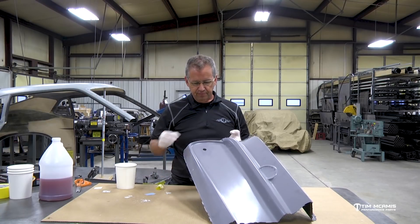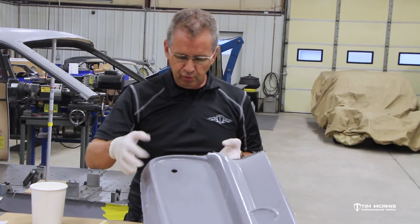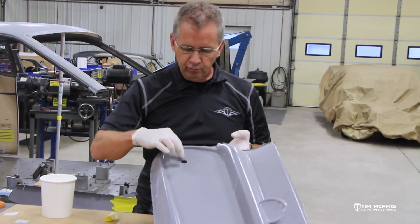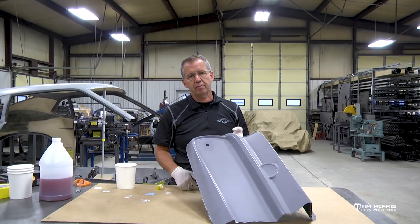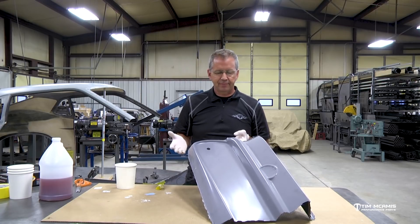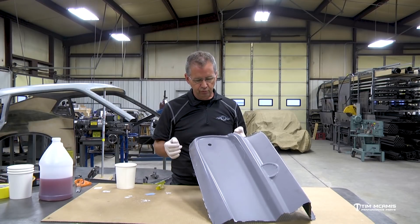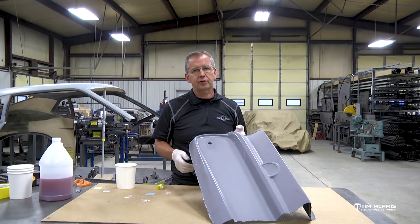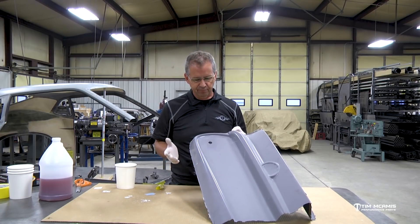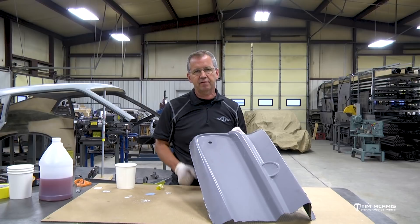Now use your new fastener, place it back on top, line it up with this hole. You may want to do both holes at the same time, but if you've got a good hole that's not oversized, go ahead and reuse it — then drill back through this hole and buck that rivet back in there. Pop rivets will work too, but I don't really like them — they don't hold up well in this material. A good solid rivet with the proper tools to buck it closed will work best because you'll get a nice tight compression. Once you do that your repair is good and you're back in business. Quick little tip, easy to repair, no problems — takes 15 minutes total and it's well worth it once you get that back in the right place and fastened back onto the front end.